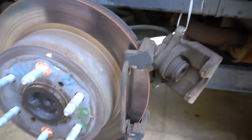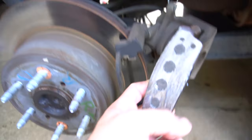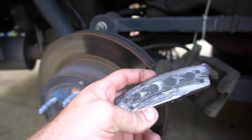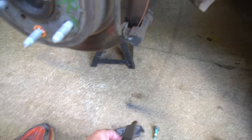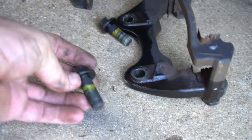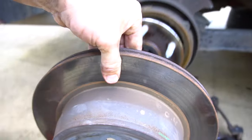Let's do the other side. I got the other side off the calipers, and yes as you can see, this is gonna be the reason why these rotors need to be turned — no brake pad left at all, and it's always on the inside. Very thin. Got the caliper bracket off, and this side was a little easier, but still you're gonna need that breaker bar.